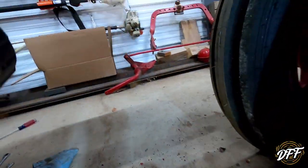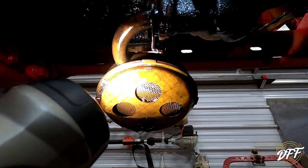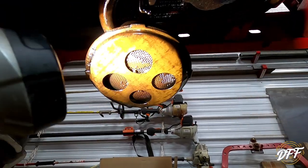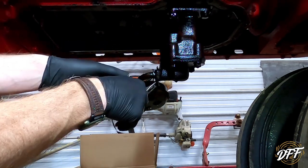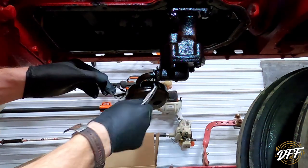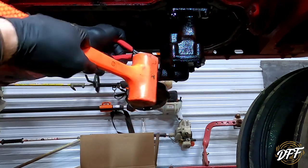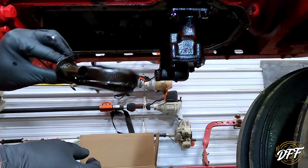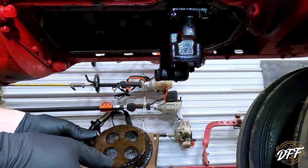Part of what I wanted to see here was about cleaning this pickup screen — taking this completely off the tractor and making sure the tube and everything here is all cleaned out. So let's see about getting this suction screen off. Never done this before. I'm hoping that just pulling this cotter pin here — where the heck is the other end of it? There it is. We'll allow this to slide out. There we go, there's the cotter pin. So what holds that in there? I don't know. Well, we got it off, so now we can see about cleaning it up.